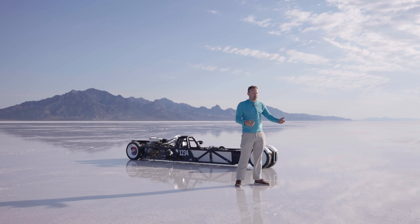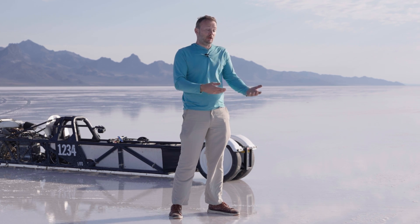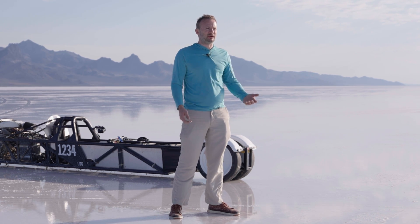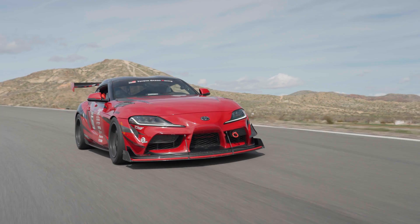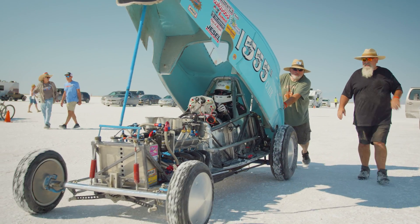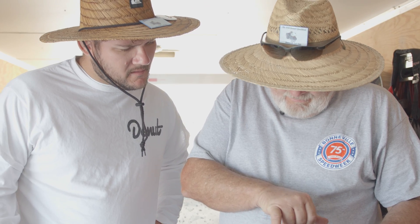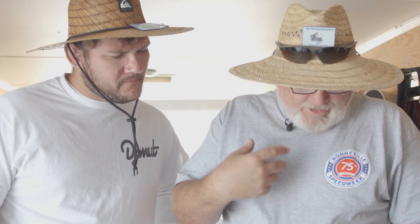You can put an air pressure sensor in different parts of the car and it'll tell you where the high-pressure area is, so you can get that ram air effect for free while also actually reducing your aerodynamic drag. One of the biggest things is temperature — once those temps are going up, that's when we start having problems with the engine or trans. We start out at over 105 degrees and once the vehicle starts moving, because of the ram air effect, it drops down to just about 90, which makes a huge difference for a naturally aspirated engine.